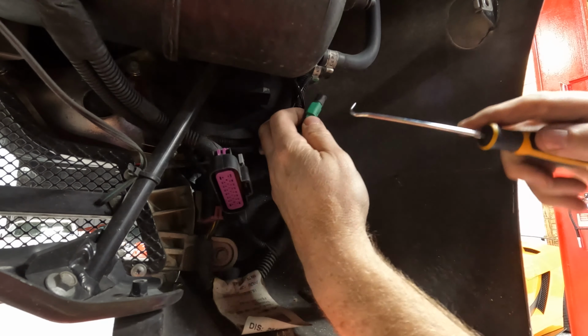There's two 13 millimeter bolts or nuts holding on this mounting bracket onto the muffler. Bracket right here. That is one of the mounting brackets. There's one here and then there's one back here. Now, I swear to God, every other 458 I've ever done, those are 10 millimeters. And for some reason, these are 5 millimeter Allens. That's gonna be much harder because that means we're gonna have to do it by hand. So anyway, we gotta get those off.